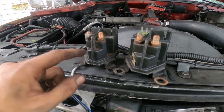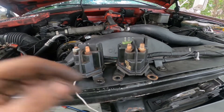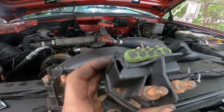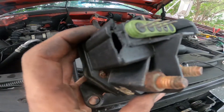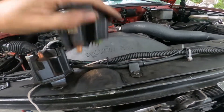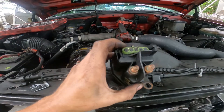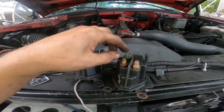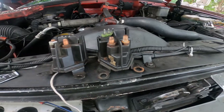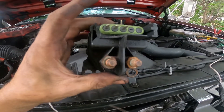Since I have a spare, I decided to just try throwing this replacement controller in to see if it makes a difference — maybe I'm not testing something right. I pulled the original out and noticed the tab on it is busted off. It's sitting right behind the diesel fill, so it could have gotten diesel in it and shorted out. There are two screws on the bottom, and even if this replacement does work it might be worth opening up the old one to see what happened inside. So I'm going to put this spare in and hopefully it'll fix the issue.